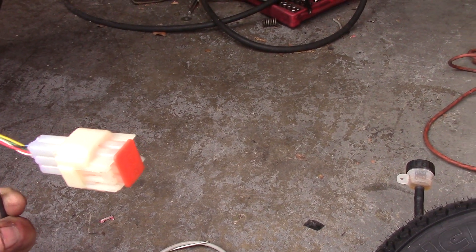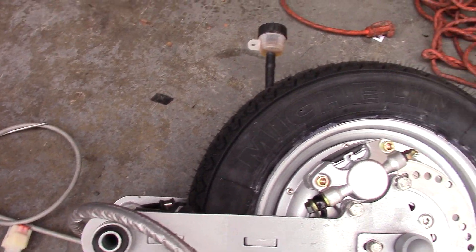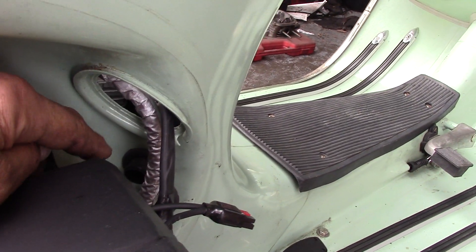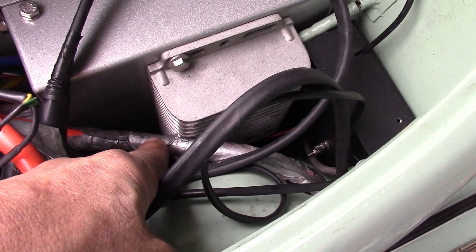The diagnostic port is capped and you don't need to mess with it. So you're only going to deal with these three wires basically. First you put the motor and wheel kit in the bike. Then you feed the wiring harness from it behind the battery mounting box — very natural — and into what used to be the air intake. You feed the wires up into there, that'll be that gray cable, so you want to feed them up through there.